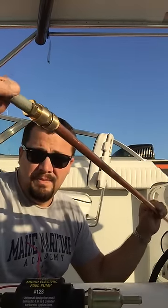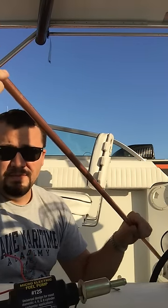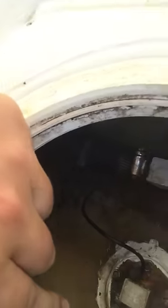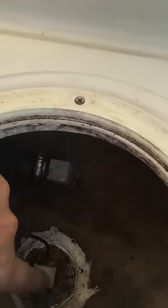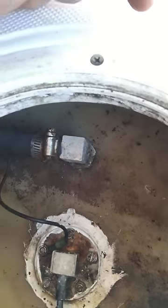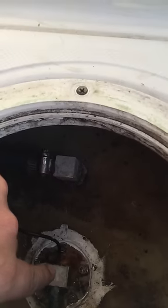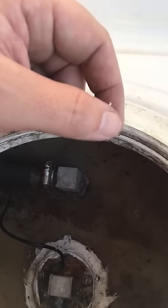So if you see now, I've got a sealed connection. I've got a brand-new pickup pipe. I'm going to show this to the very back of the tank through the sender opening. Come over here and look at my tank — I've got problems with water coming in and sitting on top of the tank. As you can see right here, that's my fuel sender. I've already sealed that but I'm going to remove it, and once removed I'm going to shove my copper pipe down to the bottom of the tank, start my fuel transfer pump, and pump all that stuff out. And that's the gist of it — that's how it goes.